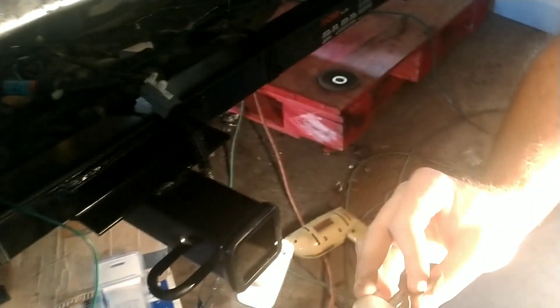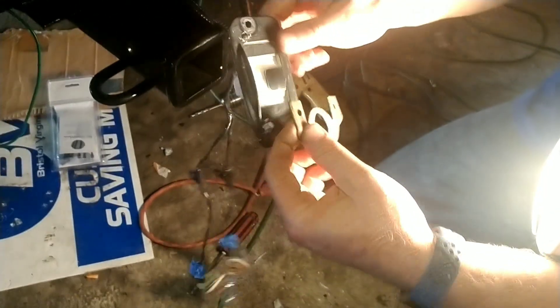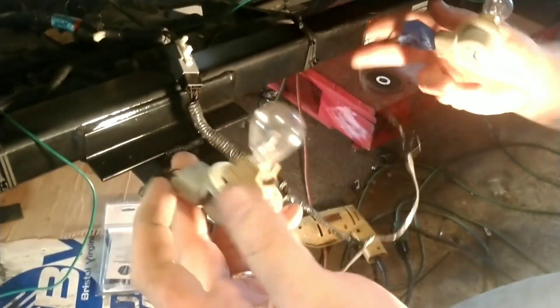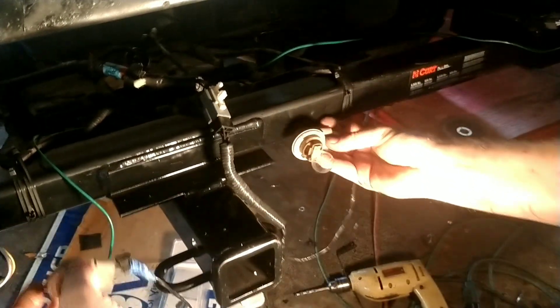For the tag light I'm using the Crown Vic tag light. Up where the original tag light went was a little bracket — I flattened that out and drilled holes where the mounting holes are, so I'm going to put the Crown Vic tag light in that exact spot up underneath there. I still need to run the wiring. For the backup light, I may go to Harbor Freight or Tractor Supply and mount it somewhere on the receiver hitch. I'm using all the Crown Vic factory bulbs — tail lights and turn signals — and I'll do the same hole-saw technique on the front turn signals.